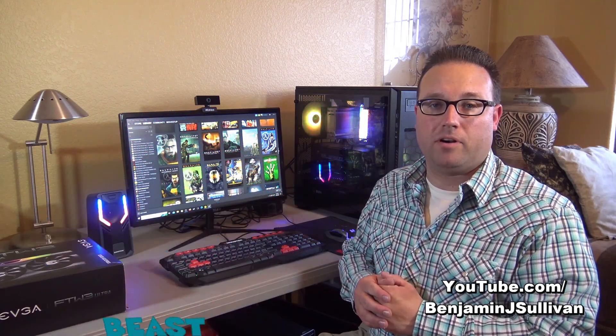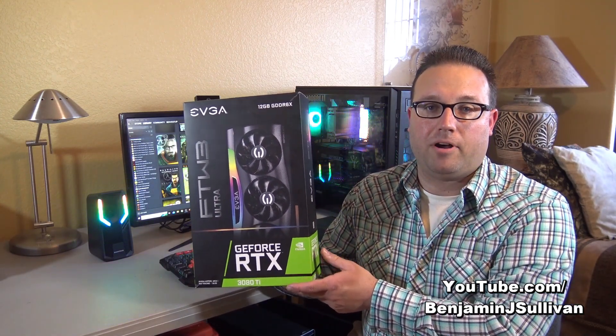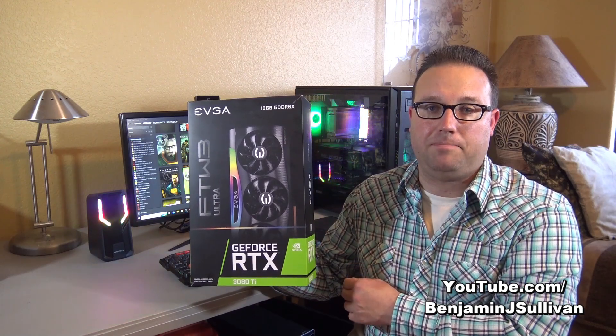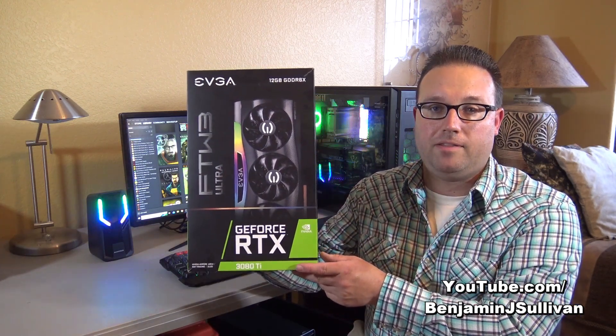In the last episode of Ben's Tech Support, I showed you how to upgrade the power supply on a desktop computer. I upgraded this computer's power supply to an 850 watt RGB, and it's working great. The reason I upgraded the power supply is because I wanted to upgrade the video card. This computer currently has a 2080 Ti, and here I have a 3080 Ti. The old power supply did not meet the minimum wattage requirements and didn't have enough 8-pin connectors. But now that we've upgraded to a new power supply with more than enough wattage and connectors, it's time to upgrade the video card.